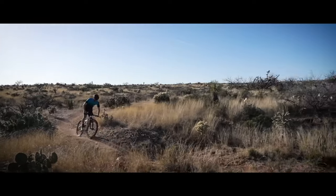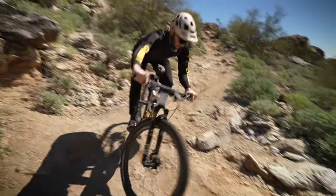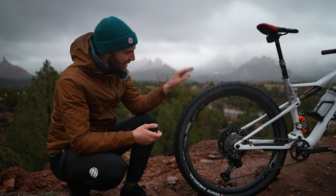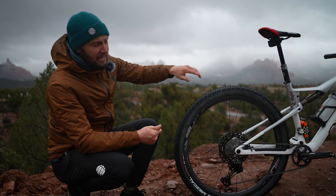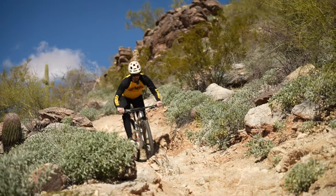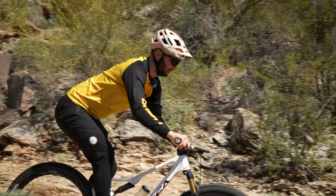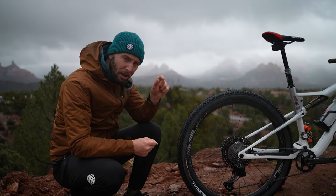When setting your bike up, have a think about what you ride most and the kind of trails you'll be doing. When it comes to pressure, adjust to suit. I'm running a lightweight insert in the rear because I've been known to get rowdy on the back wheel. They're tubeless with sealant. At 82-83 kilos, I run 25 PSI in the rear and 23 PSI at the front — my go-to pressures for ages. Experiment over lots of different tracks: get the miles in, feel how your bike handles. If it's pushing out in turns, try a different tire or pressure combo.